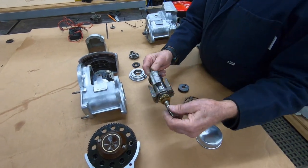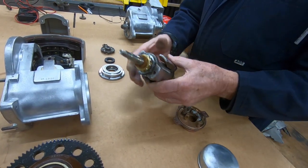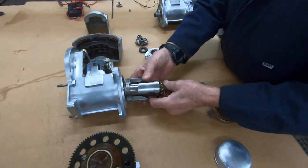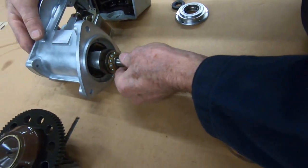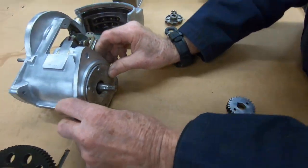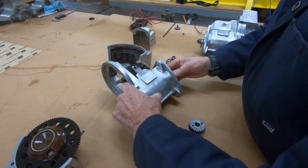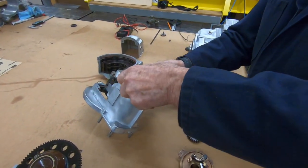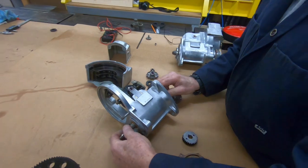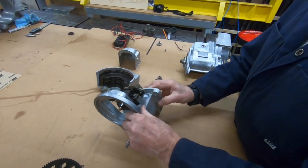This is a four-pole rotor — that's what's in here. It provides four sparks per turn of the rotor and it's got ball bearings on each end. We'll slowly assemble the thing so you can see. It goes through there like that, then the end bearing cap goes in. The shaft is hard to get lined up perfectly because the magnet is so strong.